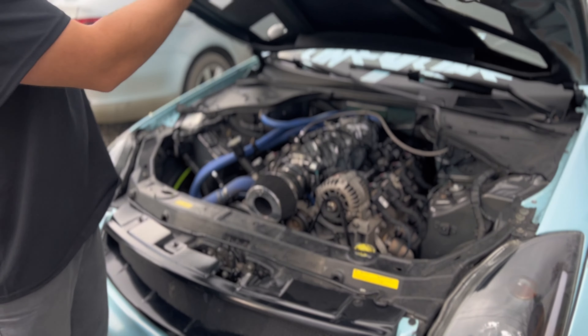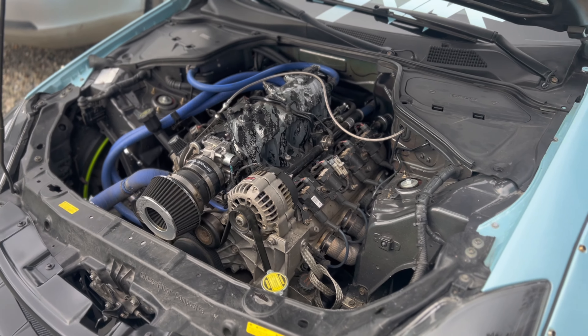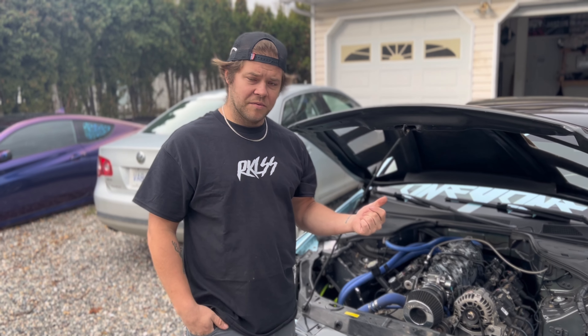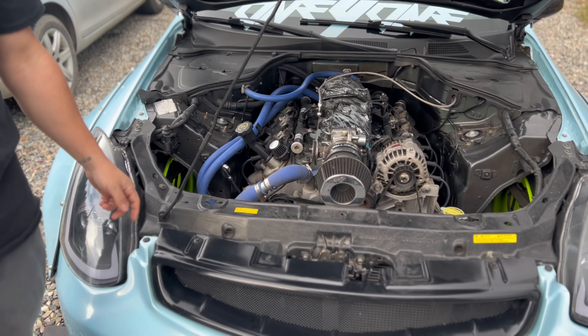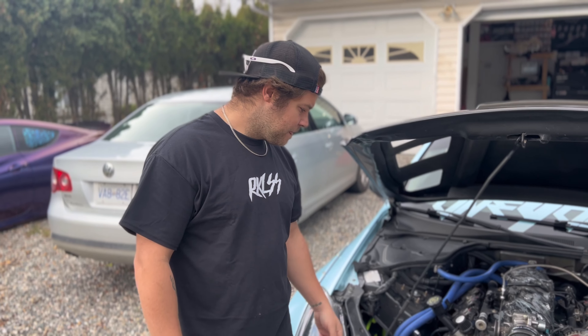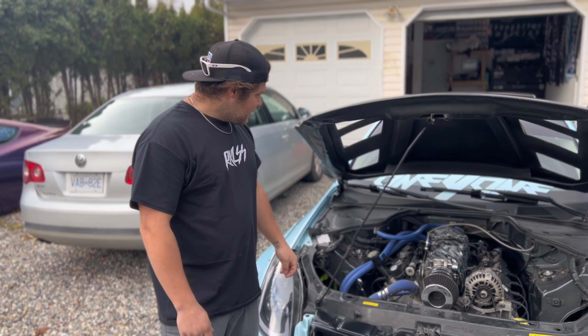VQs do VQ things, so the VQ is no longer there — we six-liter swapped it. It's got an LQ4 out of a 2500 Chevy. Somebody told me it wouldn't fit and it kind of became a 'watch this' moment. It's got Thompson Motorsport 799 port and polished heads with oversized valves. We run Johnson roller lifters with Kamali pushrods and a Texas Speed cam. I've swapped over to a four-core radiator made by Grassroots Performance out of Ontario, running two 12-inch fans — one front, one back — and that's been solving the cooling issues.